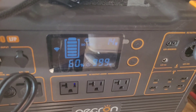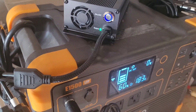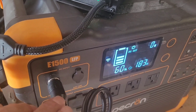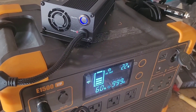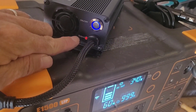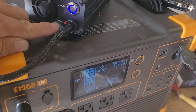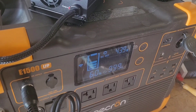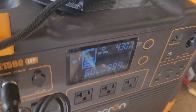Now turning on the car to see what we get at 12.5 volts. Car is on — got green. It dropped to zero but should kick up; the MPPT is analyzing the voltage to decide on full amps. There it comes — took about 10 seconds. Now on a solid red — it's popping up: was at 400, now up to 440, 439. About 440 watts at the 12.5-volt setting. Not sure what the flashing red meant — we'll see in a minute.